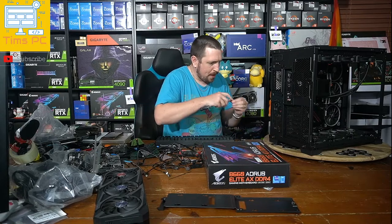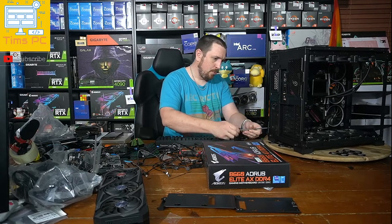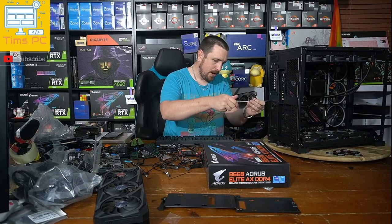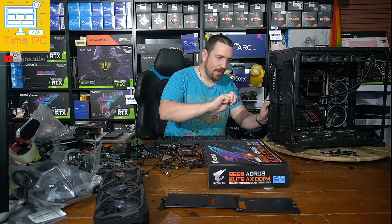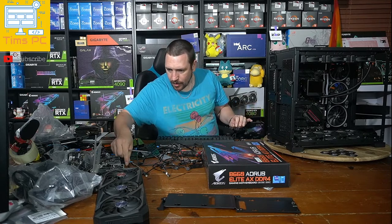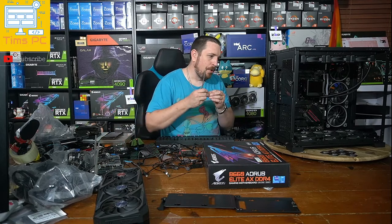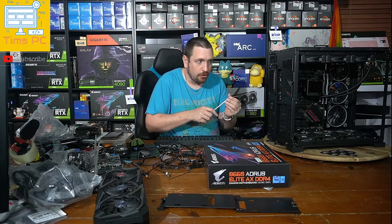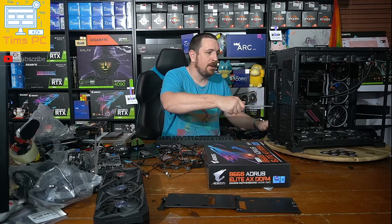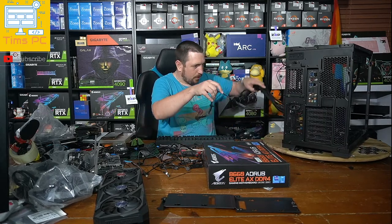Make sure that your power supply has the fan facing the panel, because if not, your power supply will overheat and you will have a very bad time with that, because when your power supply overheats, it'll shut itself off to stop it from catching fire and all that. And in the meantime, you won't be able to turn your computer back on. So what'll happen is, you'll think that your computer's just completely died on you, and then for 10 minutes you'll have a bit of an anxiety attack about it, you'll be freaking out, and then eventually you'll realise that no, it was all okay.